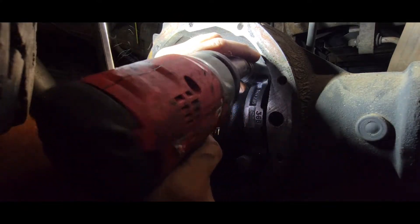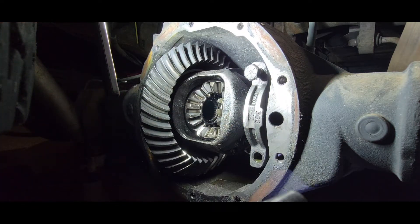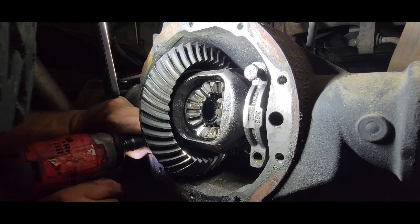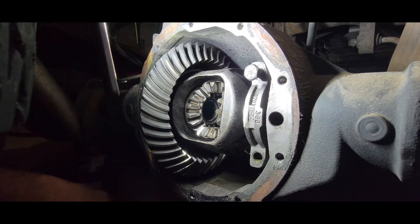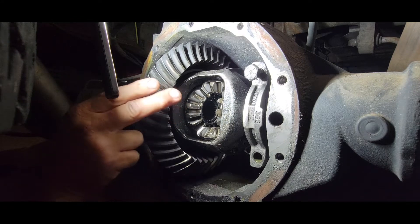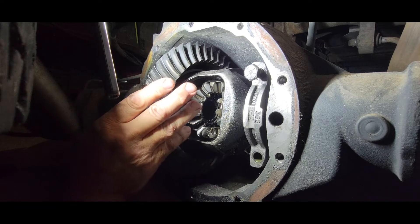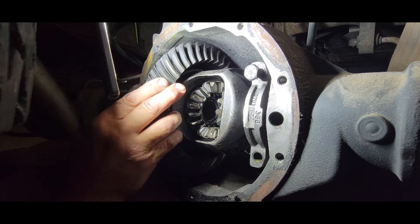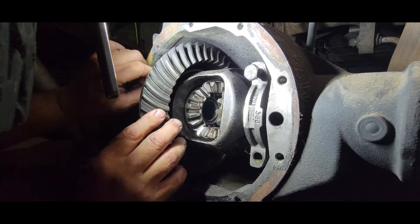These caps popped off here. Leave a little bit of thread on there so it doesn't fall off on you — you could chop off a finger, and that's not fun. It's always a good idea before you pull it completely to feel and see what kind of slack you've got. Now just by moving that I can feel it. When we put this back together we'll be using a dial indicator, but just by feeling that, it feels pretty good — that's six to eight thousandths, not too bad.